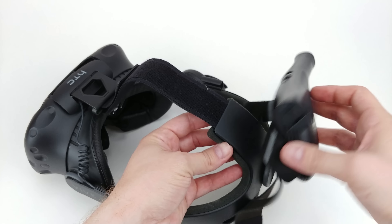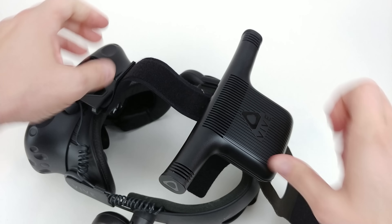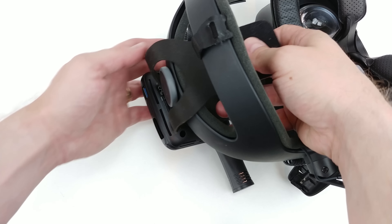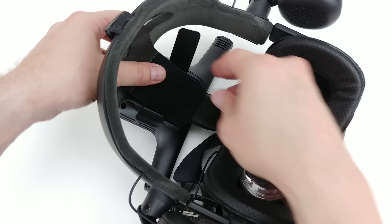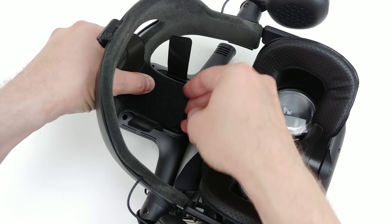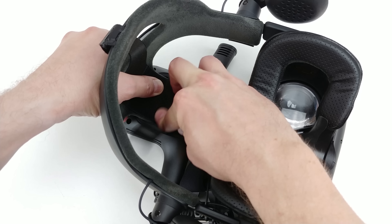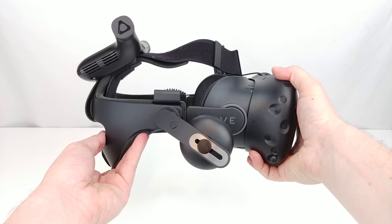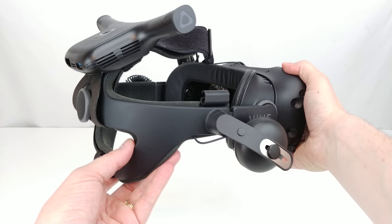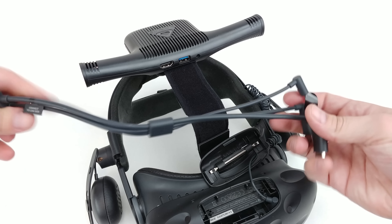It's not just the unique-looking head mount that's here. It's all the other stuff that's needed to power the headset too, including a portable battery pack, the cables needed to connect the adapter to the battery and to the headset itself, and then, of course, the PC side of things too. In order to provide enough bandwidth and a proper way of sending and receiving such intensive wireless signals, an Intel WiGig PCI Express 1X card is included in the box and will sit in the smallest available slot on your motherboard.